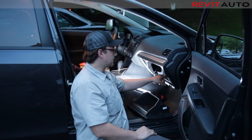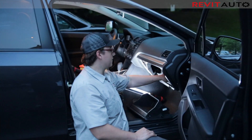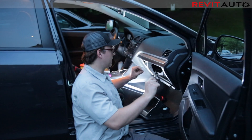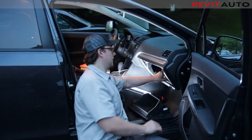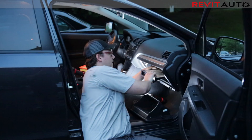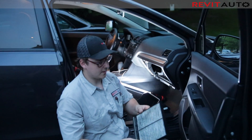From here you'll reach inside where the cabin air filter is stored and pinch on the two tabs with both fingers — there are actually four tabs in total. So you grab the two tabs, pinch and pull, and when you pull it'll bring out your dirty cabin air filter.